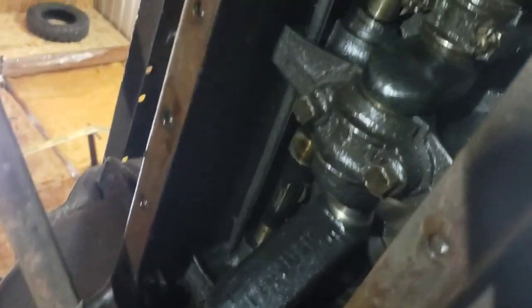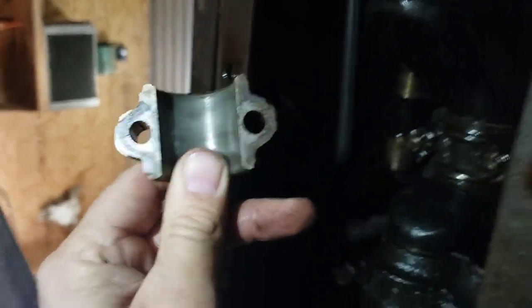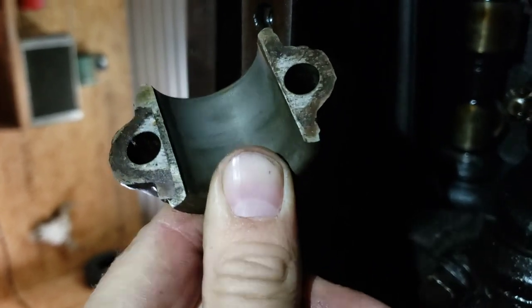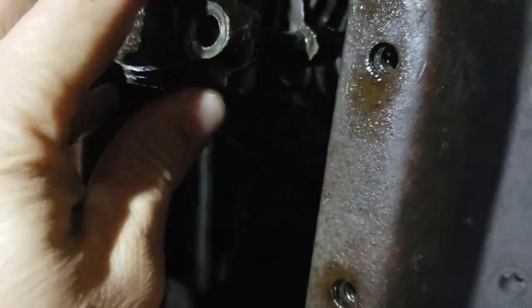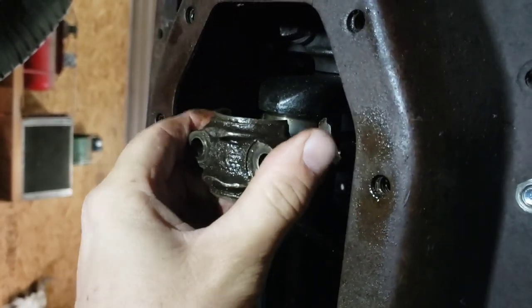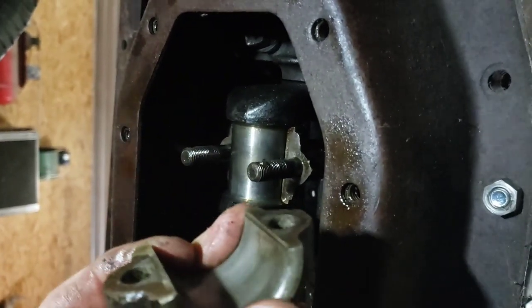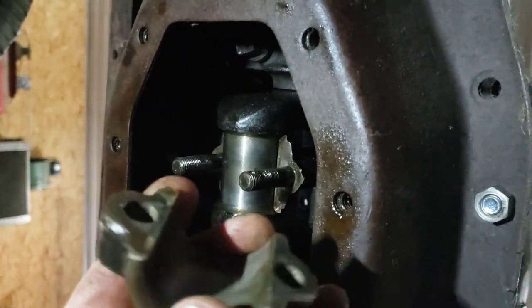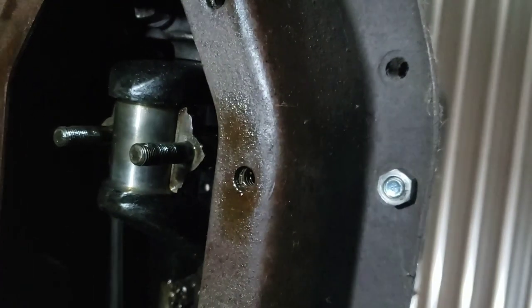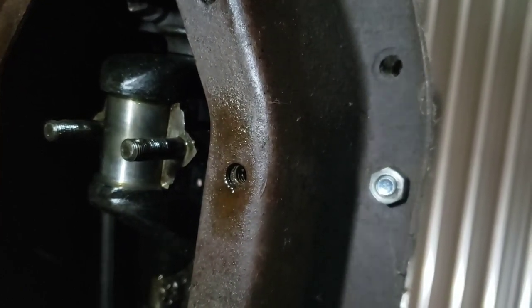With the bottom pan off, I've exposed the crankshaft bearings and camshaft. I pulled cap number one — not quite what I was hoping to find. There's certainly babbitt in it, but no shims. It looks like it's been sanded down, which is the next step once the shims are gone — you sand the cap to take up the slack. So there's evidence it has been maintained as much as possible to this point. Too bad, but given the condition of the rest of the car, not surprising. We'll carry on and see what we find.